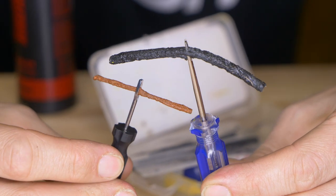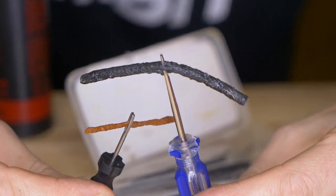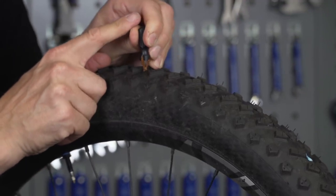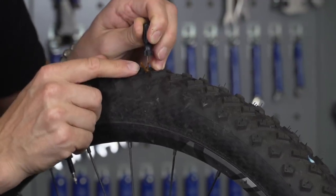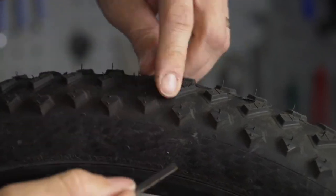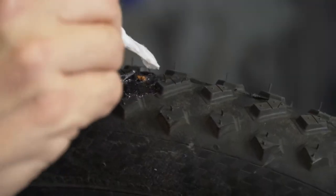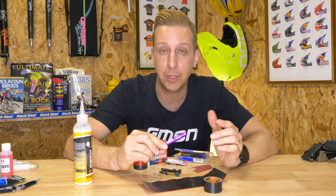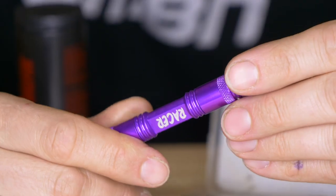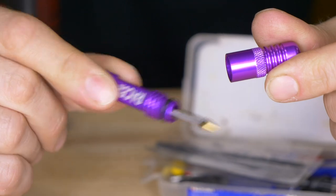For tubeless tire repair, these rubber plugs are a really good idea. You get them in various sizes and thicknesses — you literally stab them into the hole in the tire, pull out the fork you stabbed them in with, and the rubber stays in there. Don't slice off the top, and you'll be able to ride home. When you get home, use some vulcanizing solution for a more complete repair. There are also trail-focused options like this Dynaplug, which comes preloaded — stab it in, fix the tire, get going, and put a fresh one in when you get home.